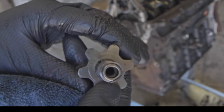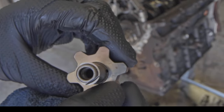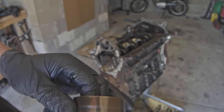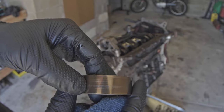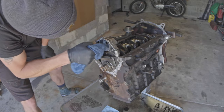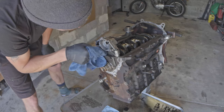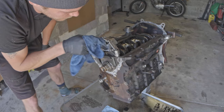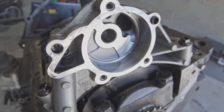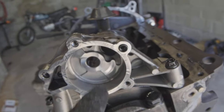The outside face is also very smooth — some tiny signs of circular wear, but nothing bad. The inner rotor also comes out, and there are a couple little grooves along the outside, but it's not bad. This is the first one of these I've opened, but it looks pretty good compared to the 1.6 oil pumps I've opened — most of those look like I fed sand through them. There are a couple little striations here but you can't even feel them, so I think this unit is just fine.